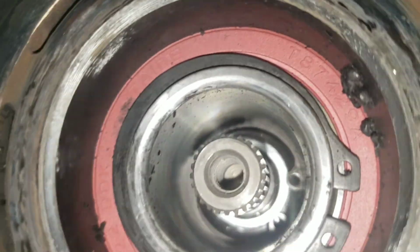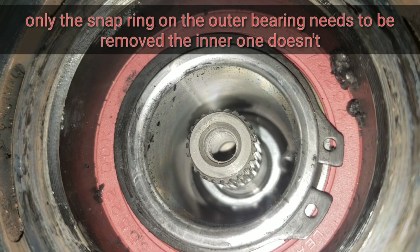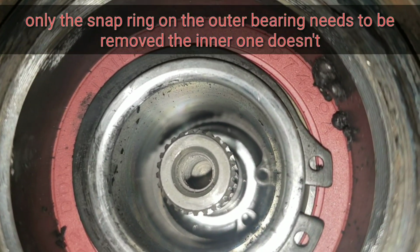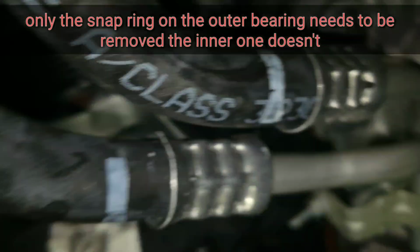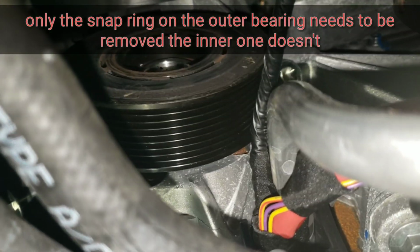and then I took the bolts. Took the bolt up there and kind of just slid it back out of the way to give myself some room. Take that snap ring out of there and then work that clutch face off and replace it.